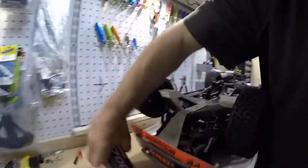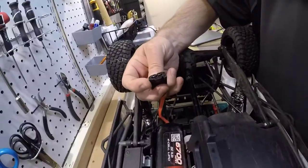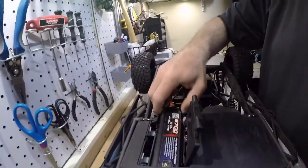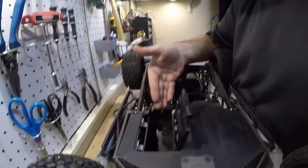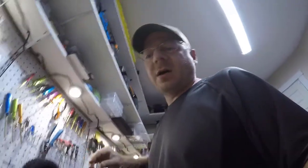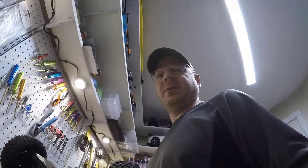Now you've effectively added depth, and in fact this battery will fit exactly right in there. The plug shape fits exactly down into there perfectly. Now you're running on a single battery 4S and you've converted the depth of the battery compartment. You're basically adding 13 millimeters — it goes from 168 millimeters deep to 181 millimeters deep.